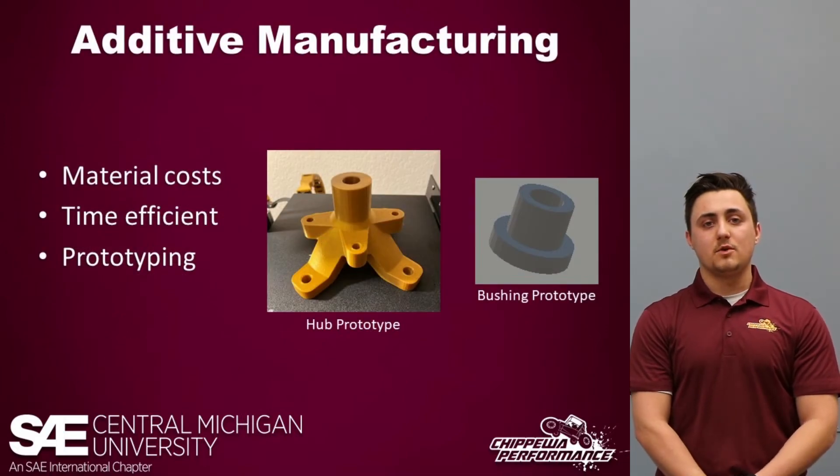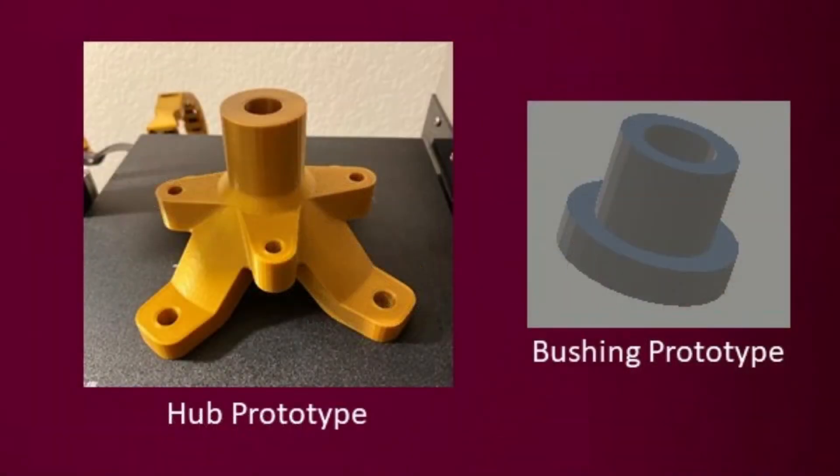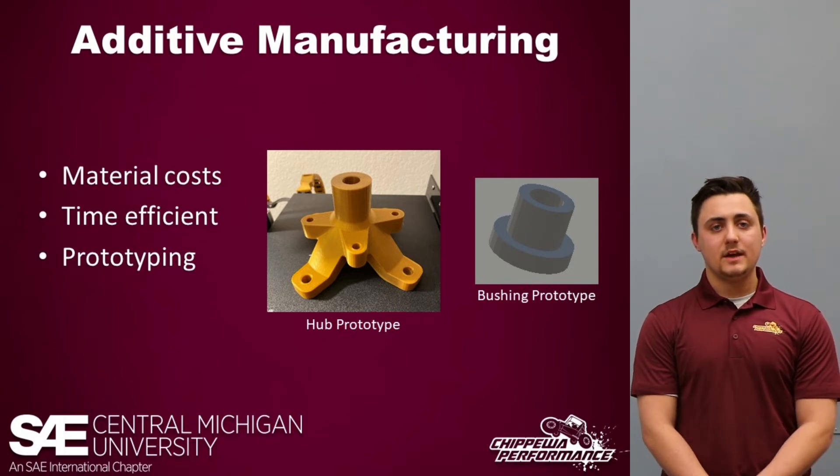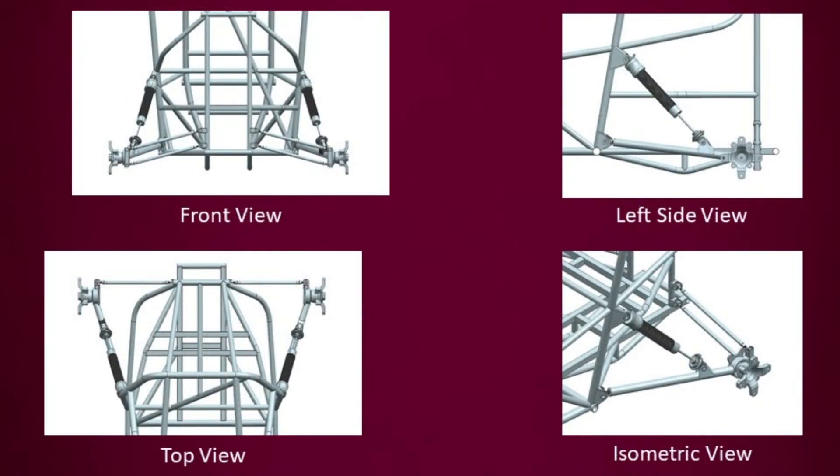This year we did more additive manufacturing to save material cost, save time, and make prototypes more cost-efficiently — we didn't have to use as much aluminum for each prototype and instead used PLA filament. This also saved time because 3D printing can be left alone to run unattended. For the front suspension, we utilized a dual offset non-parallel A-arm system, allowing a 3.58-degree change over the 11.52-inch wheel travel. At ride height, the front system has zero degrees of toe with up to three degrees of negative adjustment available for tuning. The rear suspension employs a semi-trailing arm system composed of a single trailing link from the frame to the bearing carrier, with 7.6 degrees of total change over 11.52 inches of travel.